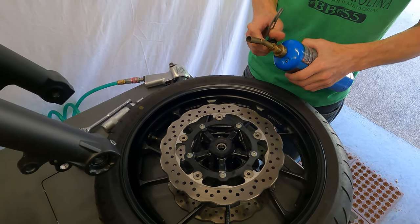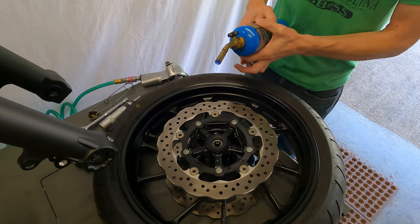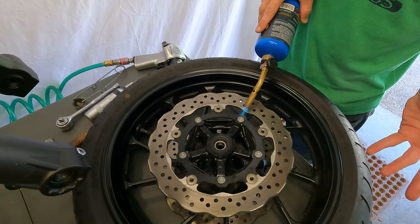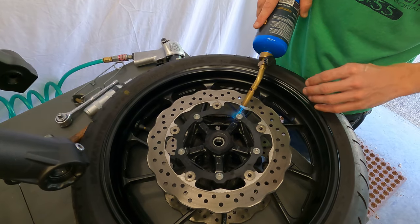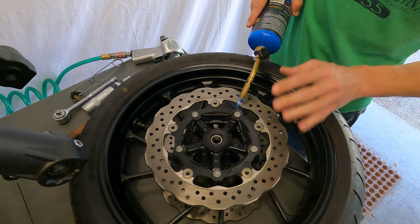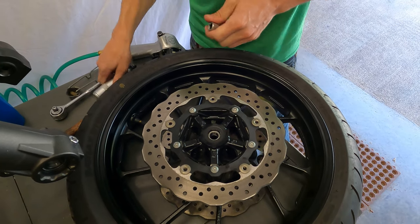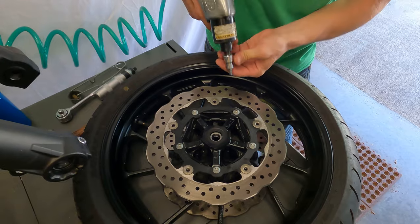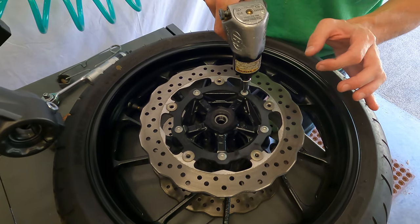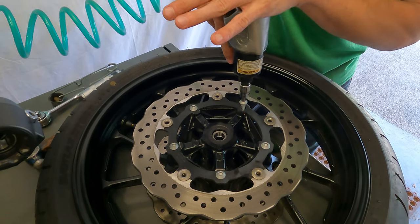The main tip is it varies — you can put a little heat on it and try it. If it doesn't work, don't keep forcing it; put some more heat on it. I'll just get our torch going. I have already preheated this one, so I'll just reheat it a little to make sure it's hot enough. These are using a hex fitting, which is pretty common — a six millimeter hex — so make sure you put your socket in all the way bottomed out, because if it's not fully seated when you put power to it, it's going to round off.